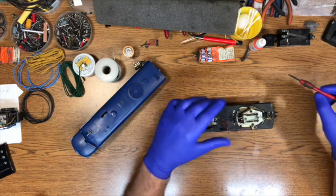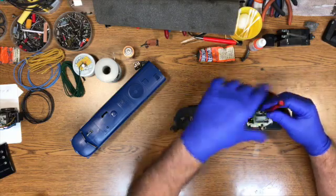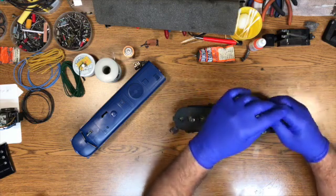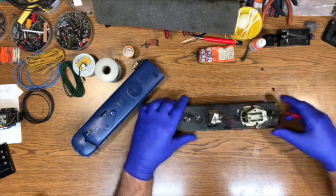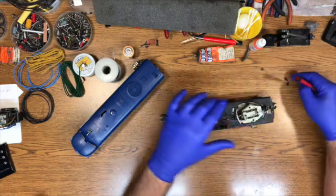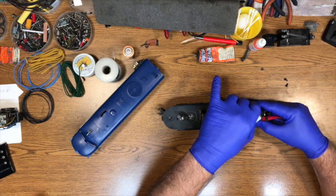All right, so anyway, I move this over here. Let's see, do I have a little tray to put this in? Probably do, but I'm not going to. Anyway, let's take the brush plate off here and see what's going on underneath with the armature and the gear location. The axle gear is just a little gear, a box down below there. It's got probably grease in it. It's probably pretty old. So I'm going to set these here. Not sure why this was hanging off, but I guess we'll find out. I'm going to try to take this off without losing the brushes too much.